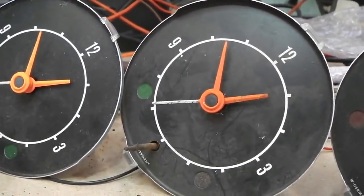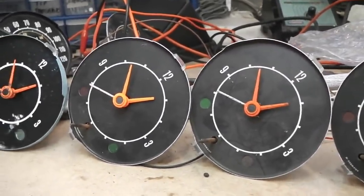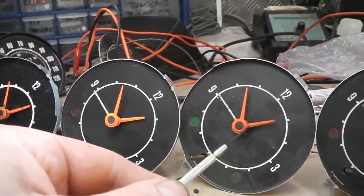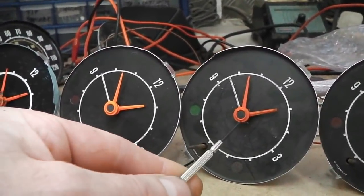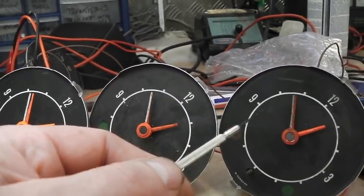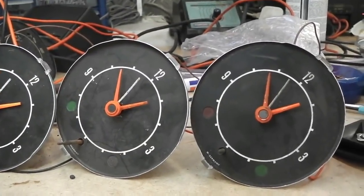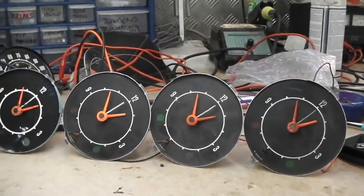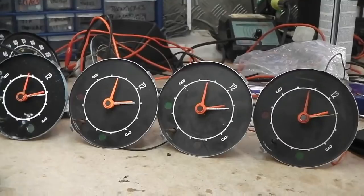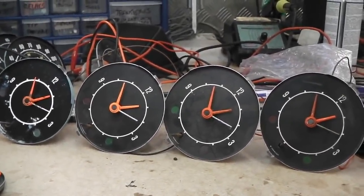The third from the left clock has kept time good, as I said. The others are variously ahead or behind. So this is how I'm going to adjust them: never touch that one. Using the second hands, they must all stay in synchronization over 10 minutes initially anyway. So if you look at them, I'll monitor those, and any that drift you just turn backwards or forwards in each 10 minute segment